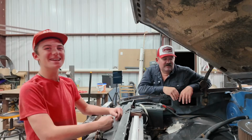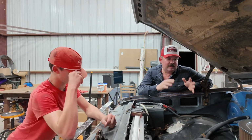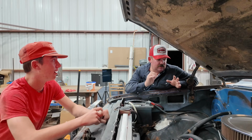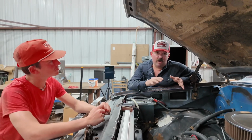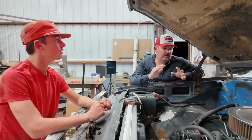All right, guys. So to finish this video up, once you've got all your oil in, you've checked everything, you've cleaned everything up, crank your truck, or your car, let it run for a few minutes, kill it, check it again, and make sure the levels are where they need to be. Don't overfill it, but don't underfill it. Make sure you're right there on that full mark, and you'll be good to go.